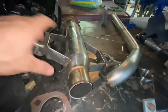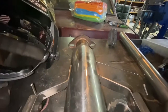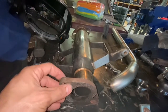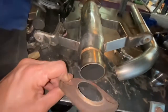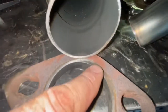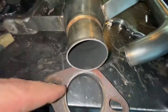The other thing I have to show you is this resonator. If I hold it straight, that other flange in the back is pretty straight, but this one over here was kind of sideways. All the customer wanted was for me to cut it off, straighten it out just like the back one, line them up, and weld it back together. I already cut it — I'm going to go ahead and grind that down flush, because when I cut it on the portaband it's flush here but raised up here.